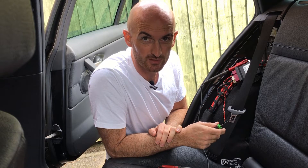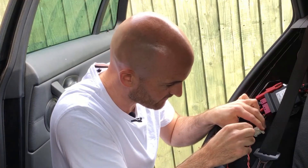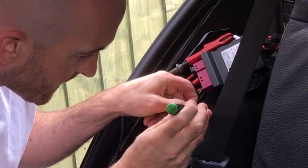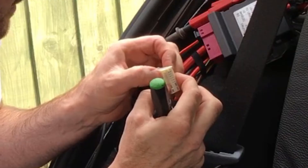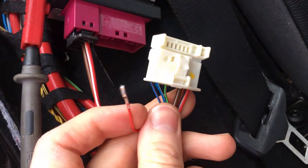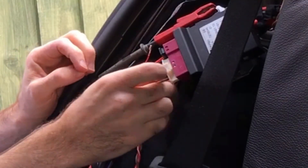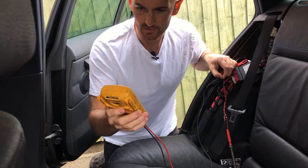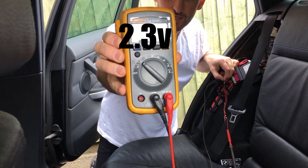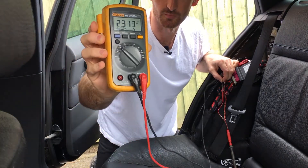The last test - we're going to put an open circuit on each wire and see what voltage we get. The red one's CAN Low, so we'll do that one first. I'm carefully opening the connector and pinning out the CAN Low. On the open circuit wire we do see a bit more of an erratic voltage, going around 2.2 to 2.3 volts. It has dropped slightly.